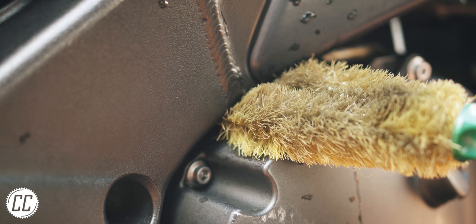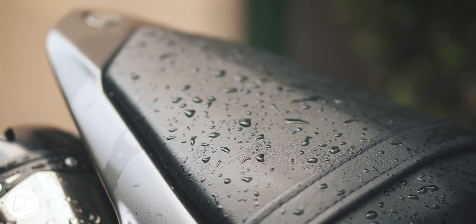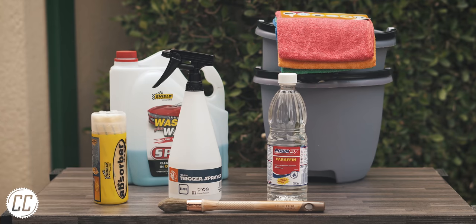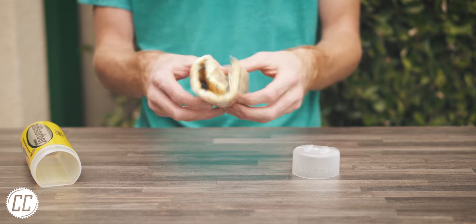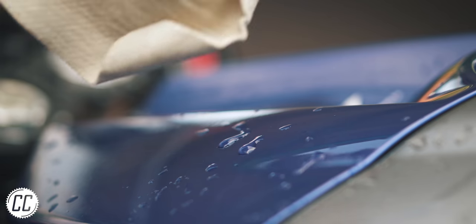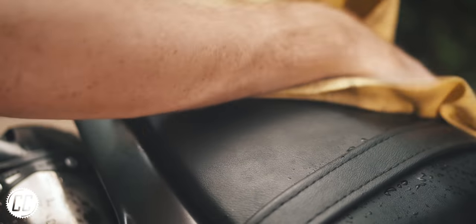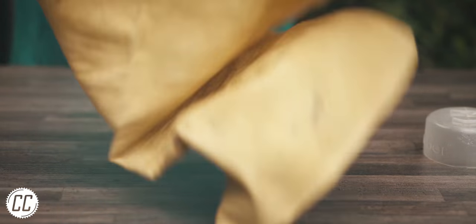And I'm sure it's cheaper than the useless brushes as well. With your bike dirt free, it probably needs to be dried. And if you're on an even tighter budget, one of those spare microfibre cloths can do the trick. But I would suggest a super absorbent chamois that gravitates towards water droplets. They go rock hard when they dry up, which shows how much they want water, and that is what makes them so good at drying a bike. Just keep wringing them out and they will keep finding all the water lying in the crevices. They also last forever and are gentle on the paintwork.